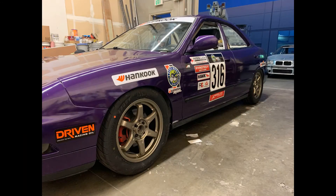The second video is going to be about the big brake upgrade, removing the power brake booster, and also a little bit about fabricating the cage. These are things that are not recommended for a street car — you don't want to remove the power brake booster on a street car. The reason we do it on a race car is because one of the problems amateur drivers have is locking up the brakes. When we make the brakes less powerful without the power brake booster, it's easier to modulate and we don't flat-spot the tires or have problems locking up the wheels. It just makes it a much more user-friendly car. I'll put all the information about the big brake upgrade in the description if you want to see what parts we used.